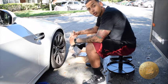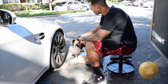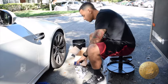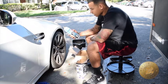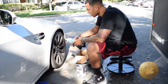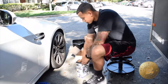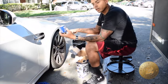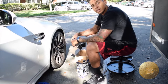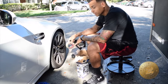First things first, we'll be removing all of the rims, cleaning up the calipers with soap and water and a towel, drying that off real nice, and then utilizing the non-chlorinated brake cleaner to thoroughly clean off the brake calipers from any debris or dust. After that, we'll be mixing up the G2 caliper paint with the activator, mixing that up real nice and thorough, and then applying the mask and tape around the areas I don't want to get painted.